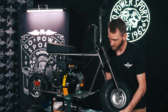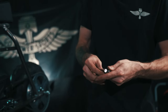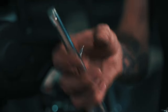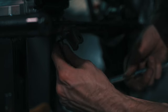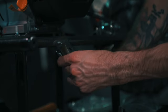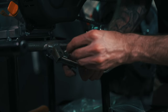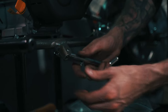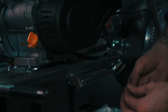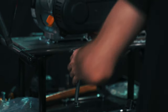And the final part: the kickstand. You're going to want to pull this pin out. The hook end will go on the pin on the kickstand, so this loop will go around this up here. Get the kickstand in there — luckily these springs aren't crazy strong. You should be able to get it right in there. Your pin is going to go through the back side of that. Easiest to do this with pliers. And there you have it.